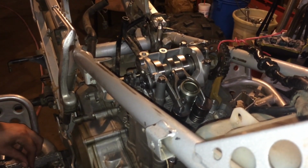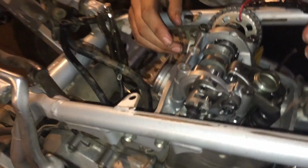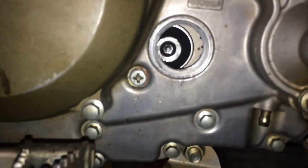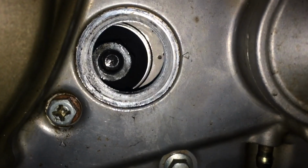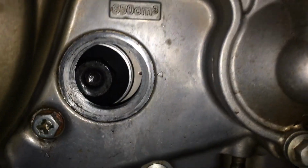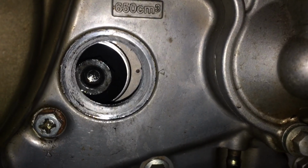If this was just a maintenance type of deal, the valves were worn a little bit, you should probably just go a step or two up and you should be pretty close. True. But make sure while you're doing this, you're probably going to end up taking the cam off over and over again. There shouldn't really be any reason it happens, but you just want to make sure you stay on TDC so you're not losing any clearance with the cam pushing down on any of the lifters.